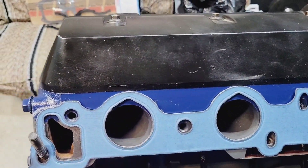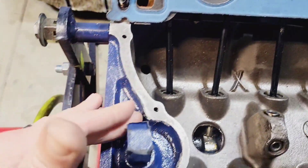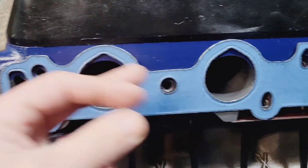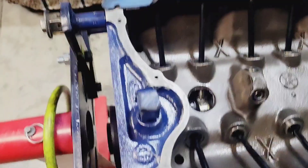Here's what the gaskets look like — I just laid them down here. I had to pull the intake manifold; I'd RTV'd this up so it's just kind of dirty now. I've got to clean up some of this lint in here, blow it out with the air gun, wipe it all down with brake clean, and make sure I can get another good seal.